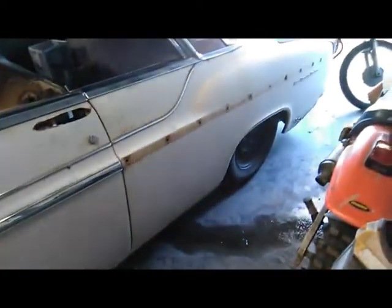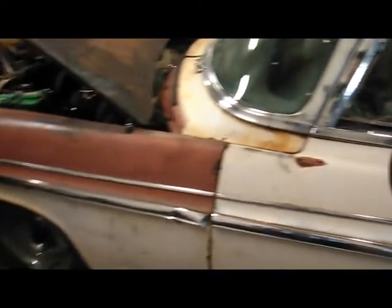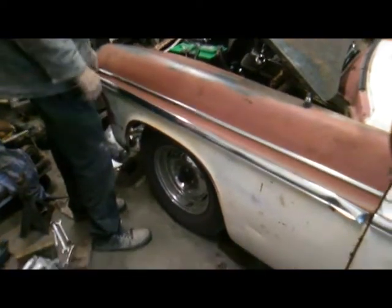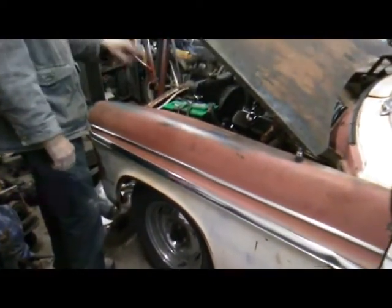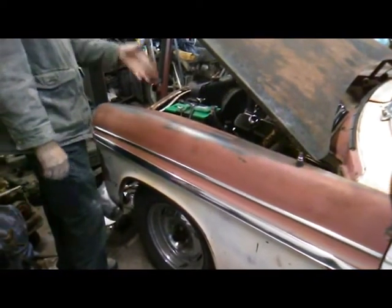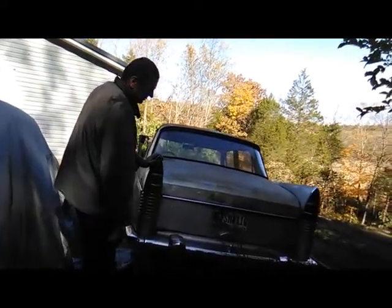And the bottom half of the steering column is Dodge Dakota, and it had the sliding double D steering shaft, and it slid right into that Chevy Cavalier. Really? Yeah, just slid right in there to the U-joint. And then if you had the stock steering setup on this thing, a set of B-body headers would just go right on this car. Yeah, we used to pull a trailer full of dirt bikes on it.